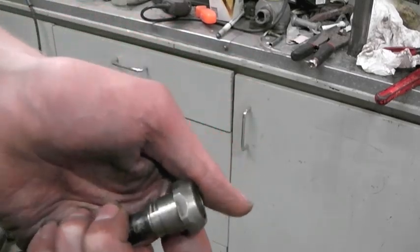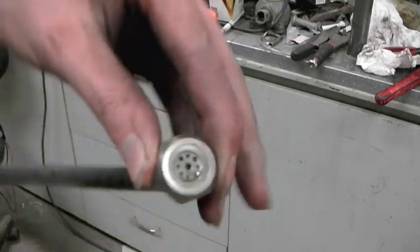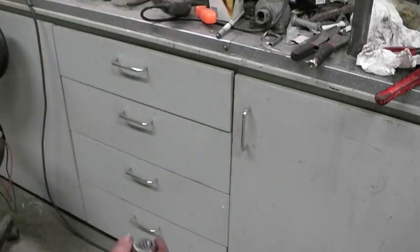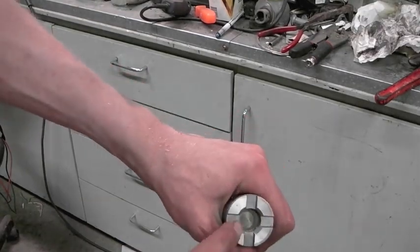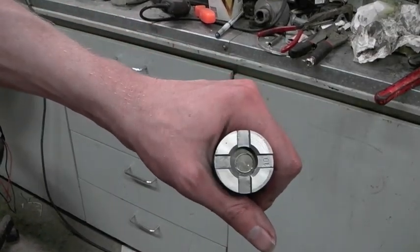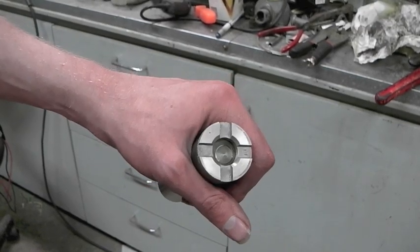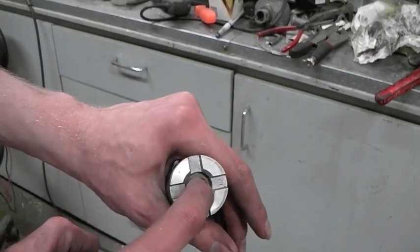I've got a piece of line on this — it blows up through the two holes in the sides. It's a limited opening, but it's an opening. Looking at the cylinder, it's got a sprung washer deal up top too. I'm not sure if that's just another restriction sort of deal or if that's some kind of check valve so that the compression and the rebound are different. I don't know enough about tuning shocks for production vehicles — I don't know if they bothered with that — but yeah, more valving.